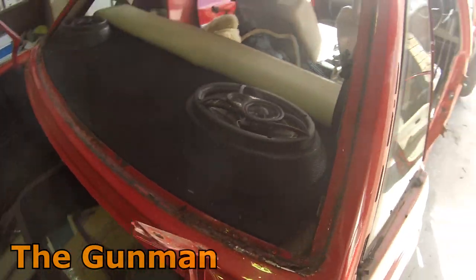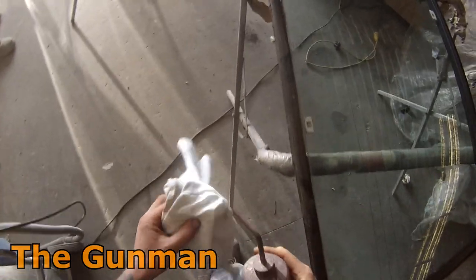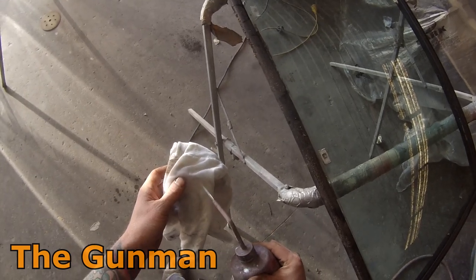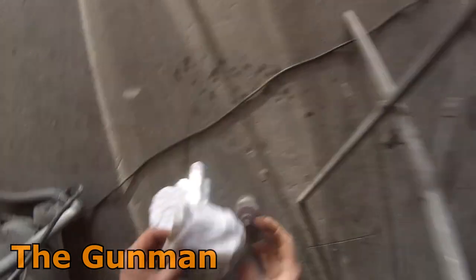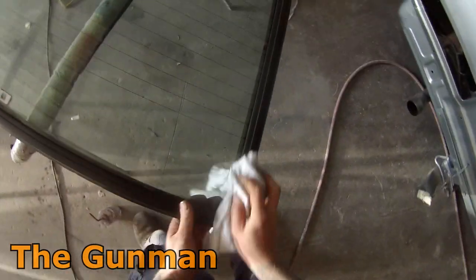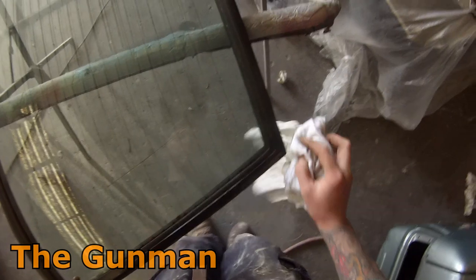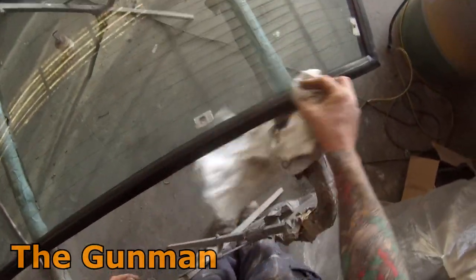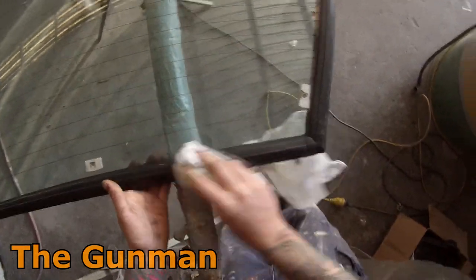Just clean the entire edge and you'd be able to install it again, but for a front windscreen — a urethane windscreen — I'll usually leave that one to the pros because it's a bit harder to pull out and a bit more important to install correctly. For rear windscreens and older cars, lots of the old cars have front and rear windscreens with a similar setup to this.